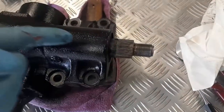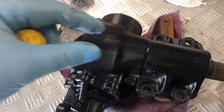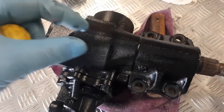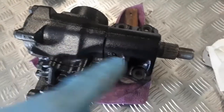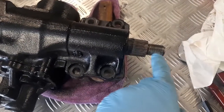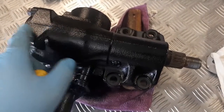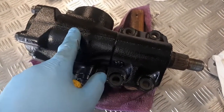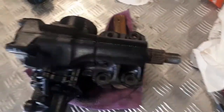So when you wind that screw down, you're forcing this down, which is forcing the taper on those gears I said before to jam into the piston gears a bit harder. So if you go too hard and wind that in, and this comes down as you wind it, you'll end up binding in there where your sector shaft teeth meet your piston teeth. It's like chucking a wedge under a door. You'll jam it. So I just go in till it gets a bit hard to turn and back it off a tad. But then we'll try it in the truck anyway.